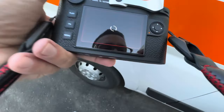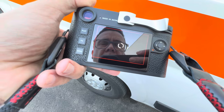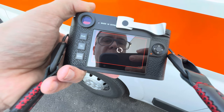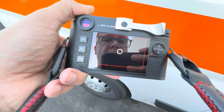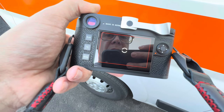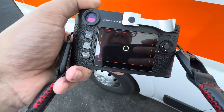A couple of things have been happening to me other than the freezes: if I put my eye to the viewfinder and then remove it, the screen will remain off. It's not that I turned off the screen — I checked. I'd have to reset the camera and then everything comes back to normal, where the sensor turns off the display when I look through the rangefinder.